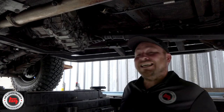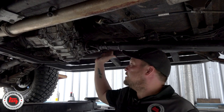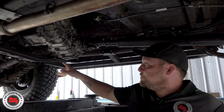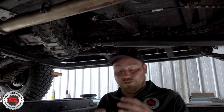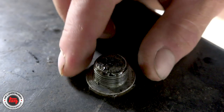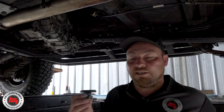The 60's up on the hoist now, so it's always good to do some initial checks. We found some play in the rear tail shaft front UJ, so we know we need to address that - it could be making some noises. The front UJ on the gearbox flange has loose bolts, which could make a lot of noise especially in four-wheel drive and low range. When you drop your oil, check the colour and check for swarf - metallic remnants in the oil. Your magnet in the sump plug will show a little bit, but you're looking for big chunks really.